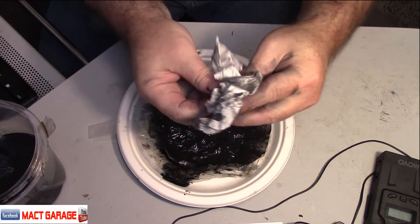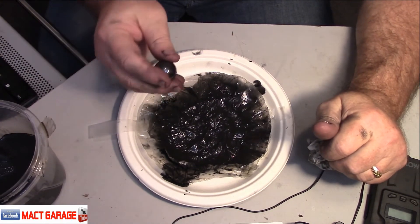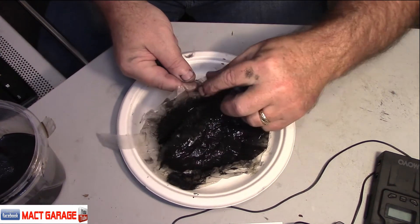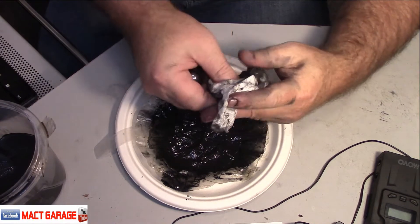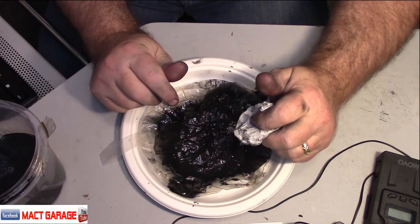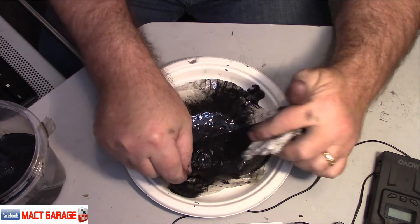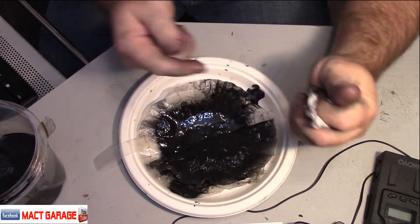Overall folks, the black stuff that you're seeing is the additives that are getting eaten up during the process of it running — that's why you see the black. If you notice the outside of this is all oily — that's your mineral oil, or highly refined hydro-cracked oil, or whatever oil it is, depends if it's a synthetic or other type of oil. But you can see the difference with the oil. This here is full of the essentially oxidized additives, and then the outside is the base oil. So you see this black? This is additive.